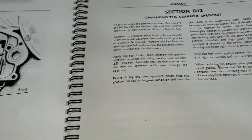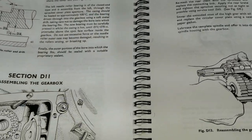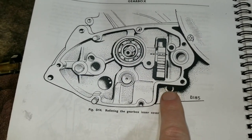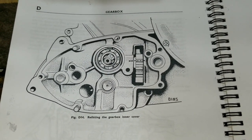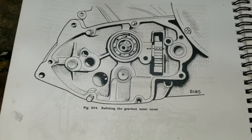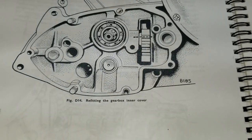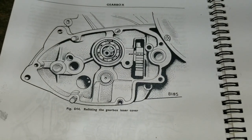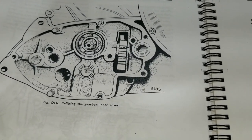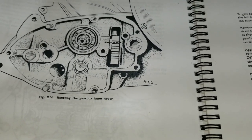A few things to clarify: leaf spring transmissions were only for '71s and '72s, because in 1973 they put the plunger back in and removed the leaf springs. So this is kind of a '71-'72 walkthrough only — the transmissions are all the same pretty much, just little details here and there. The plunger would probably be easier to put together. Also, '71 was kind of the first year of an optional five speed, which actually jammed five gears in there — a total of 10 gears inside. Some race bikes got six gears, meaning 12 gears inside. We had a heck of a time with just a four speed.